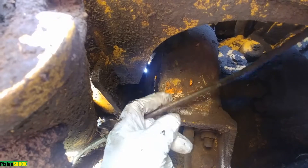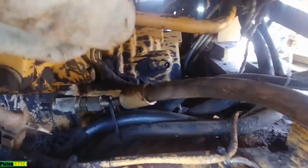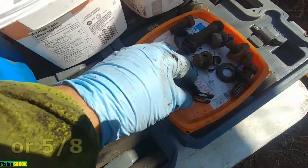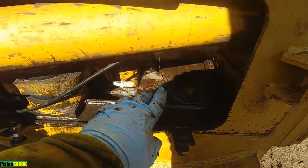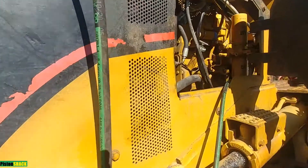There is one bracket on the side of the frame under the cab on the left side that you have to remove — that was the hardest to get to. You can get there with a 16mm wrench and remove that holding bracket, and that will be almost victory. Then I kept pulling the line towards the engine, removing as much dirt and debris as I could.